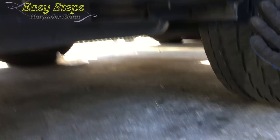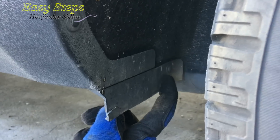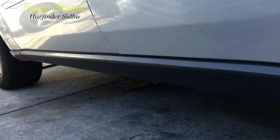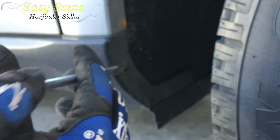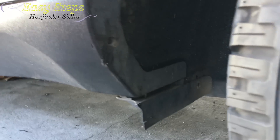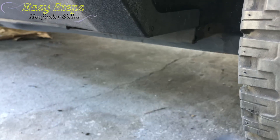There are going to be three plastic push pins — one, two, and one at the bottom, three — and this is for the rear. There's also going to be three in the front, so we're going to have to pop all six off and remove them. Just use a flathead screwdriver. After removing all three, you're going to pull the bottom plastic clip off.